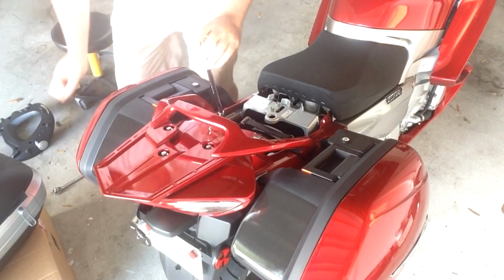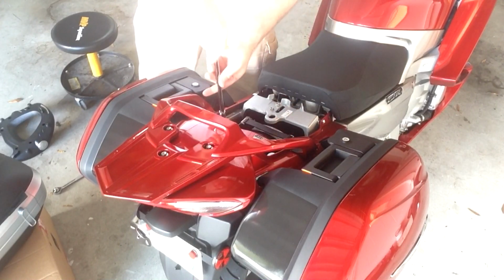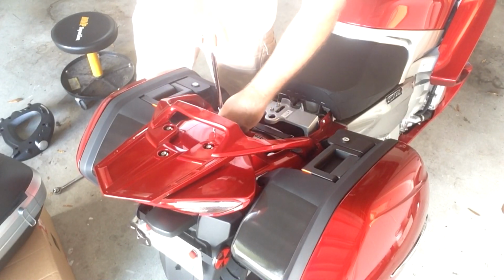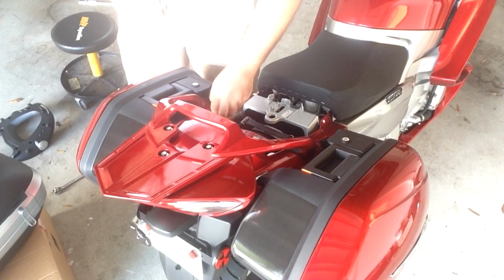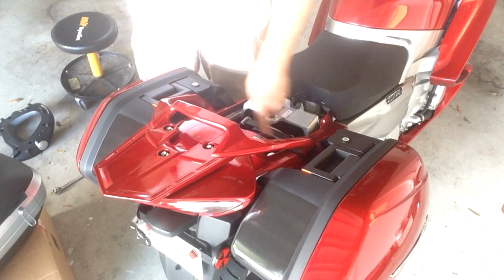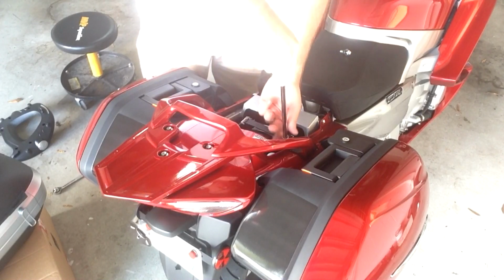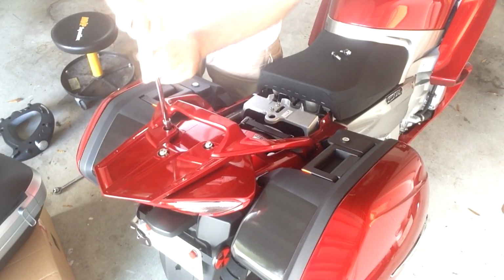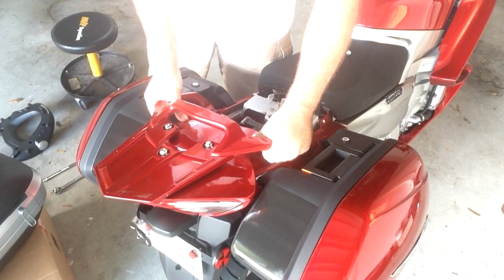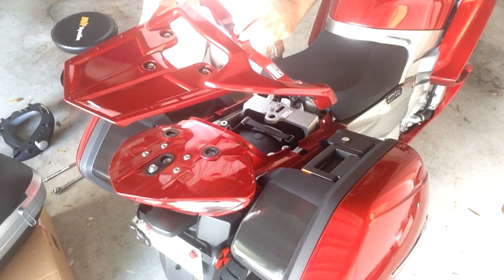What you want to be aware of is what's underneath them. We have hard washers under these 3. We have some larger kind of padded washers under the bar here. Just keep everything together, especially if you're going to do like I do and be taking it on and off. So these bushings here go through this cross member down to the frame. These stay together. Let's go ahead and remove the rest here. Now we can lift off the grab rail assembly. And I'm just going to keep these guys together in the hole and set this aside, so it's easily put right back into place.